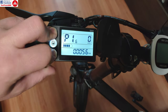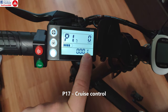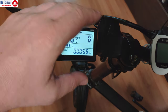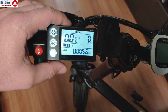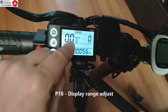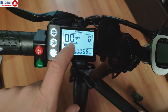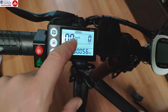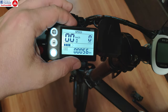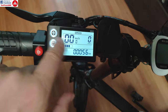P17 has the cruise control option, and you can enable or disable it. Sadly, on this bike I haven't managed to make it work even if it's enabled — the bike comes with it disabled, and holding the throttle constantly will not engage cruise control. There's a big chance that this doesn't work on this controller. P18 gives you the speed ratio. If I set that to 150%, I'm going to get a 50% increase of the shown speed — so if I'm doing 10 km/h, the display can show 15 km/h. Leave it at 100% because you don't want the display showing incorrect values.